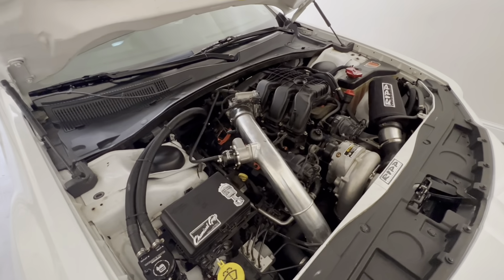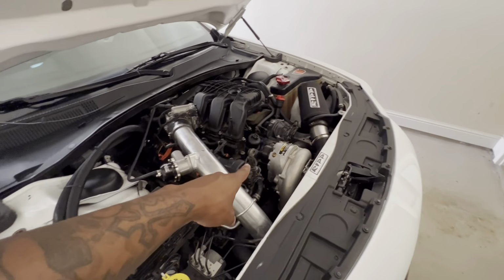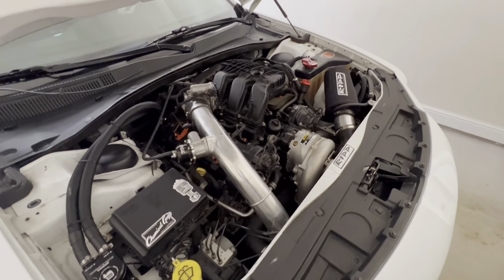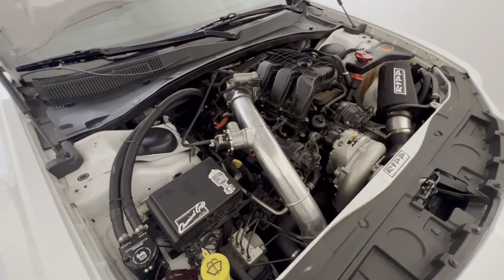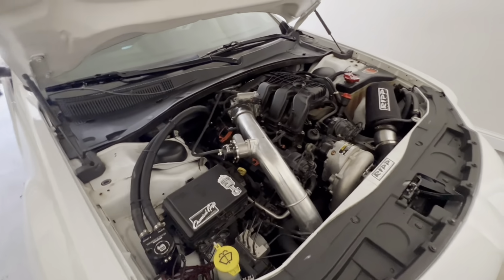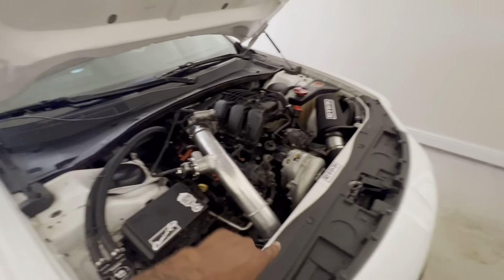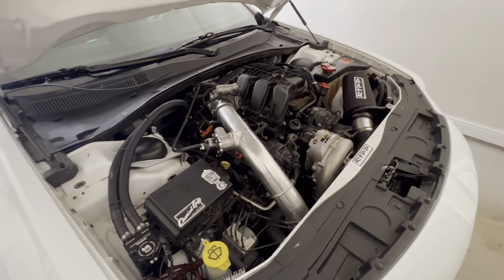And for my new guys, if you're a new subscriber here and you made it this far, I've had this kit on here for a little over 30,000 miles now, about 32 or so. And this is the first, I guess you can say, kind of issue I've had. And again, you're going to have to replace spark plugs whether you got a boosted setup or not. Depending on how your car is tuned, this may speed up the process for when you need to replace them. But again, I replaced those plugs before I ever got any of this put on there. So the plugs have been on there for about 40,000 miles, give or take. Probably a little more than that, actually.